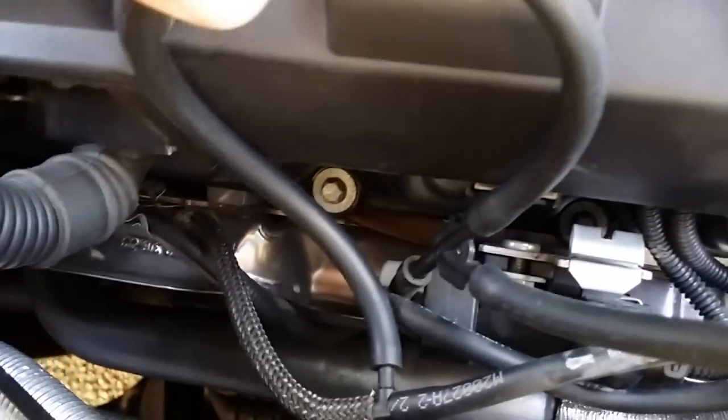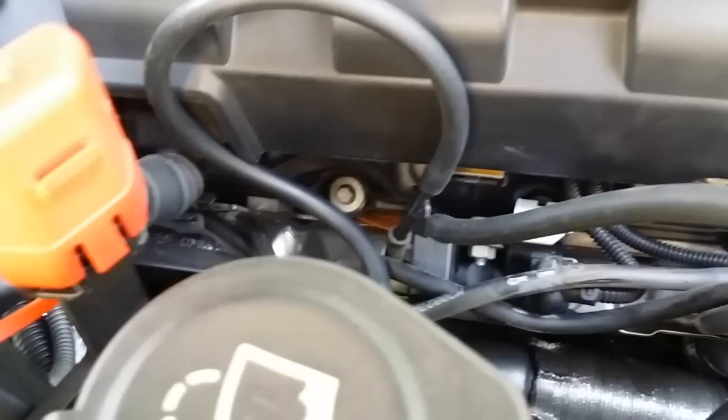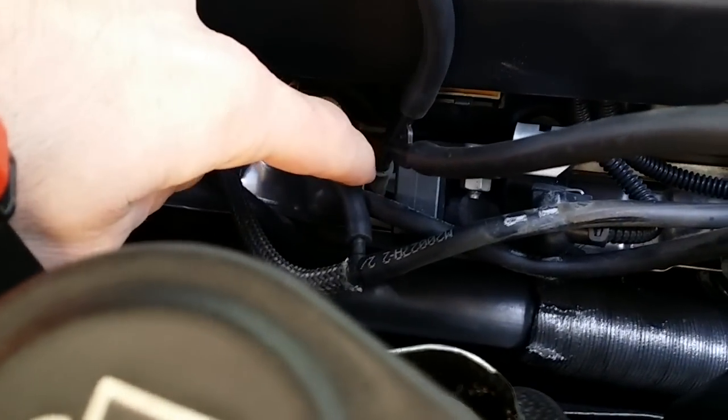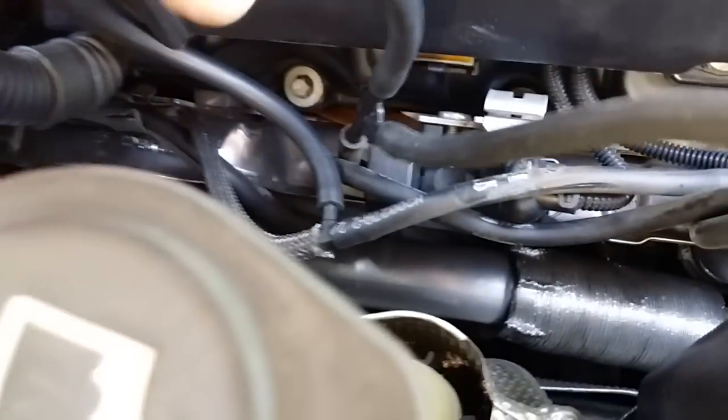The only catch is when you're pulling these vacuum lines apart, they are very brittle, especially if your car is older. Those of you who used to have a JB2, you know, circa 2007 might remember this. But you can use a little screwdriver to kind of pry at this line so that when you pull everything apart, they pop right off rather than break in one of these T's or whatever.